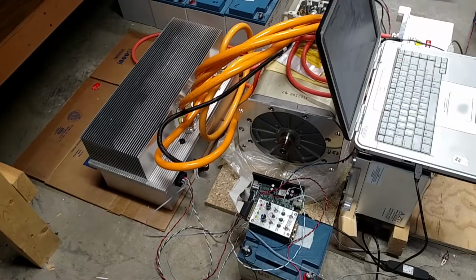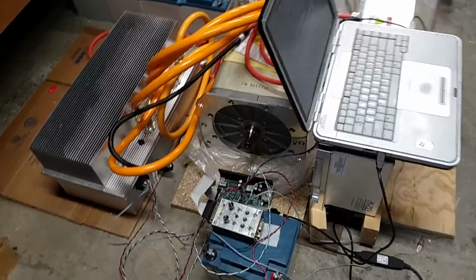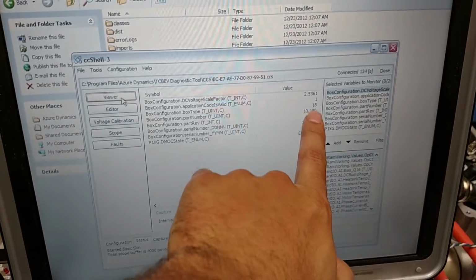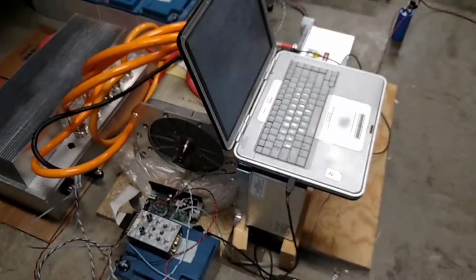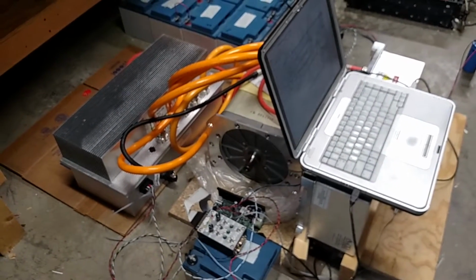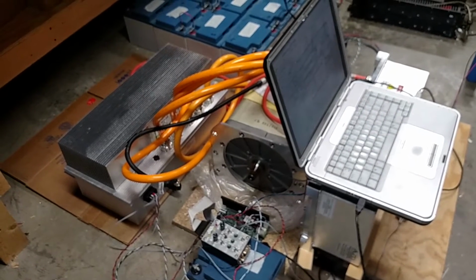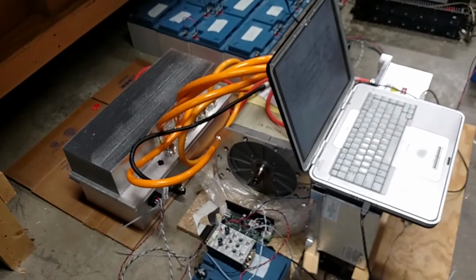And the other way, which I think I might pursue, is CC shell. Since it can read that byte right there, and it also has the ability to write to the EEPROM, because that's how we sniffed everything. We know it's just sending over a data structure, and it'd be interesting to see if we can craft a serial packet that modifies the byte from 17 to 18 and then commits a save to the EEPROM.